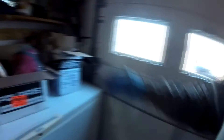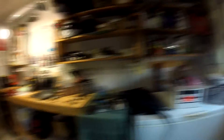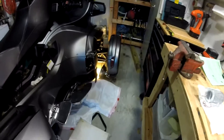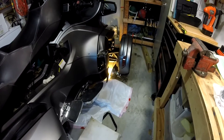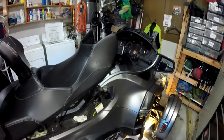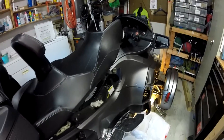I went ahead and ordered my replacement parts kit straight from Can-Am, which was quite handy at about $85. It comes with the oil you'll need for the change, the filter, and gaskets. I've also prepared my workspace — I've got my drain pan ready. My technique to keep things neat is to have the drain pan inside a heavy trash bag, so when I'm finished I just turn the bag inside out after draining the oil into a storage container and everything stays tidy. Before draining, I unplug the oil filler port so there's airflow and no vapor lock.